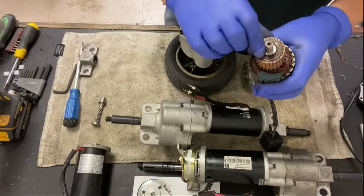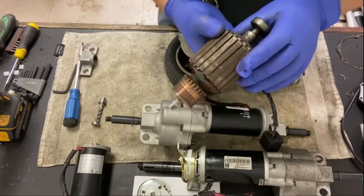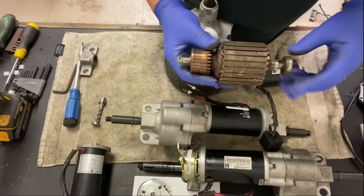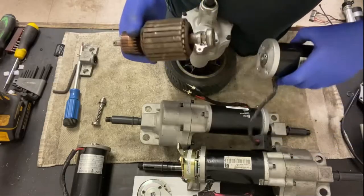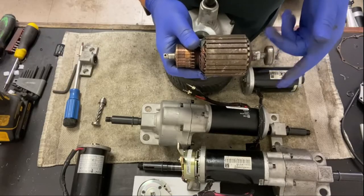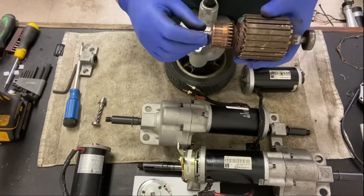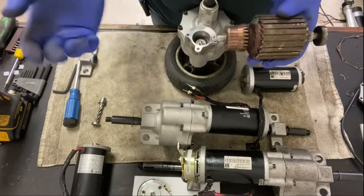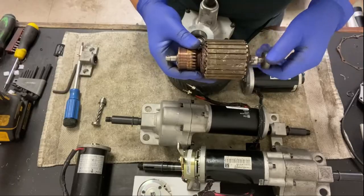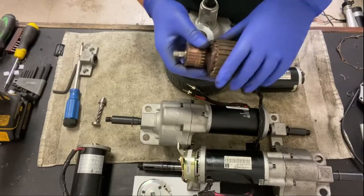It also creates a lot of dust, and it gets inside the windings, which you can see better on this one, where the dust is just building up and building up. It gets inside. There's two bearings, one on either end of the motor, like that and that. And these bearings get clogged up with this dust over time, and they can make noise or even just lock up completely, causing resistance on the motor, and it would work harder, get hotter, and give you drive time issues, as the length of the scooter's run will start reducing because this is working harder, pulling battery power, and your range will go down.